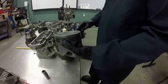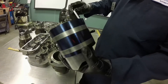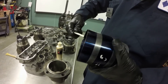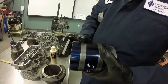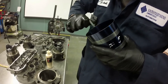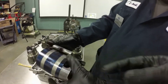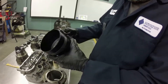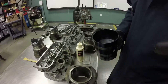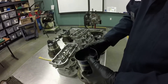The first thing we need to do is compress the piston rings. This is a ring compressor — you place it on the piston like so, then crank it down and compress the rings. It's really important that we get this tightened down as absolutely tight as you can to get those rings compressed all the way into the piston. There's no gaps around the bottom or the top — we've got the piston compressed really well. To put the piston in the cylinder, we need to orient it correctly. There is an arrow on the end of the piston that shows which direction is the front of the engine, so we've got it oriented correctly.